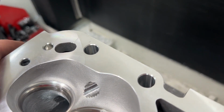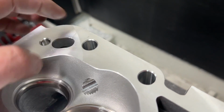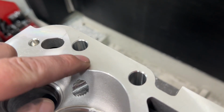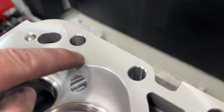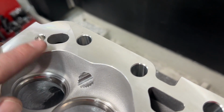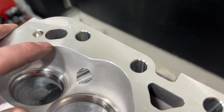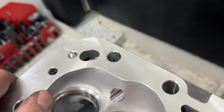It might seal up when you first install it. Maybe you torque it down. Maybe it doesn't leak water, because the fire ring, by the way, would go right through here. And maybe it won't initially. But eventually what's going to happen is you're going to blow a head gasket. Probably somewhere in this area because this is higher than that one, or just this whole area here. Regardless, you might seal up at first, but a couple heat cycles and it loses a little bit of tension. You got a leak. I mean, as long as you put good parts in them, it'll be okay. No.